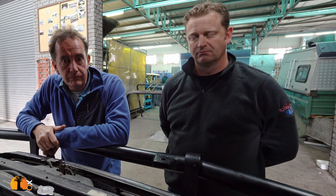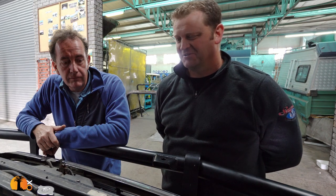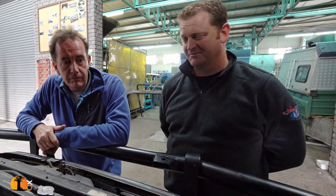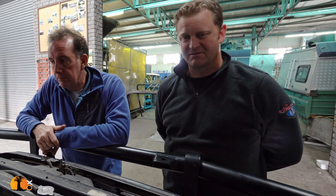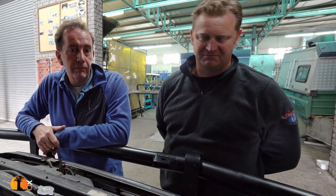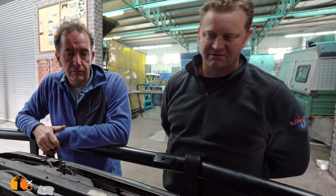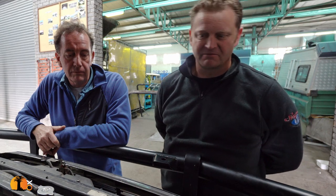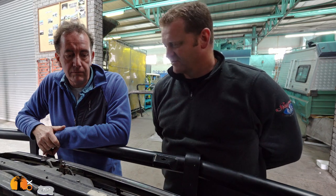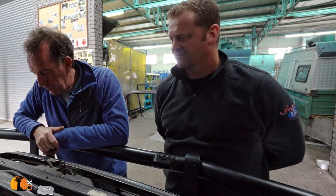What have you seen in the last two minutes? This bonnet has been open. I think this integral part has been butchered. I can count the faults in five seconds: the radiator is shot, the electric fan is not right, no aircon belt, wrong manifolds. There used to be an intercooler that was taken out.